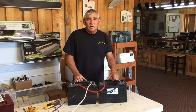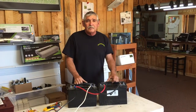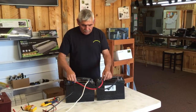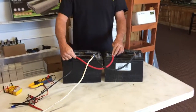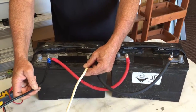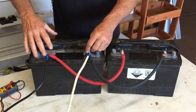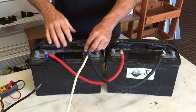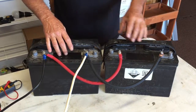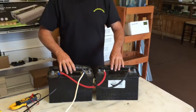We're going to talk about the 12-volt batteries. A lot of RVs that have been coming in here are connected in this manner, where the positive and the positive of the 12-volt are connected and negative and negative. But what we're seeing is the positive and the negative to the RV are connected off of one battery. With this being done, you're only using the power from this one battery — very little from this other one.